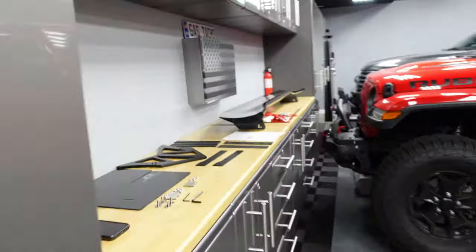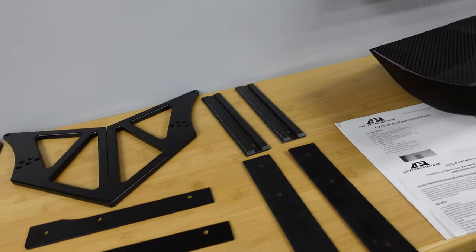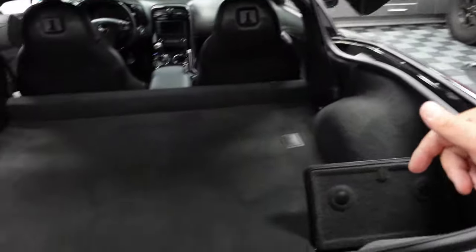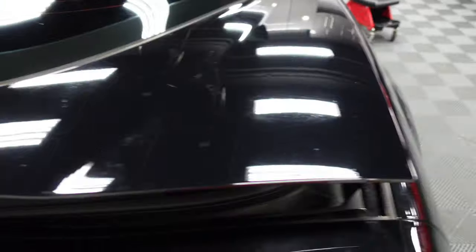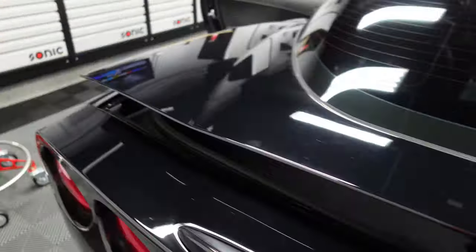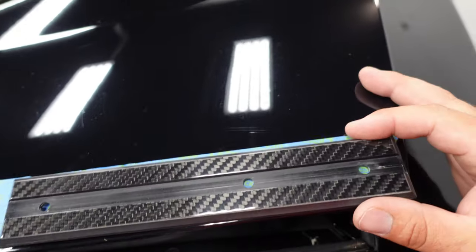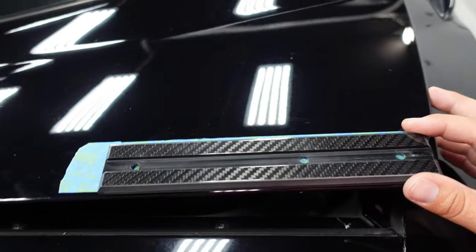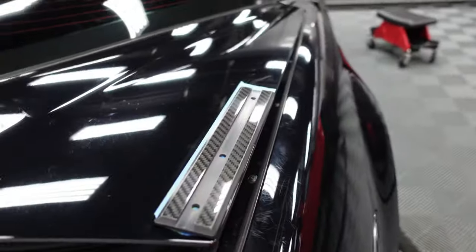Fun job next — we're gonna do the wing. These are all the parts. I'm gonna read the instructions and at each step I'll let you know what I'm doing. We gotta drill some holes in the trunk lid. Battery's still unplugged, so I left a wedge here so I can work with the lid down. I believe the holes get drilled right here and here. I'll mark up the trunk and check in with you in a bit. Pretty easy so far — just put some painter's tape down, and here are the brackets I need to mark where to drill. The biggest thing is you gotta line up with this edge, not this edge.